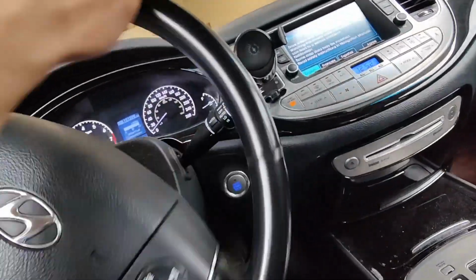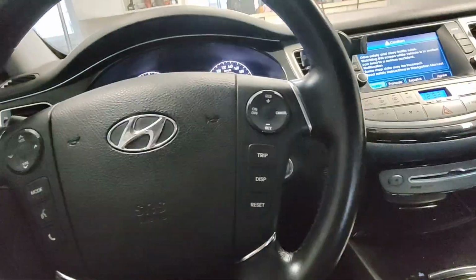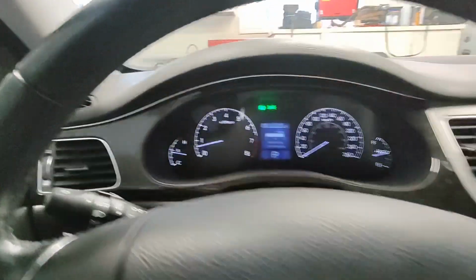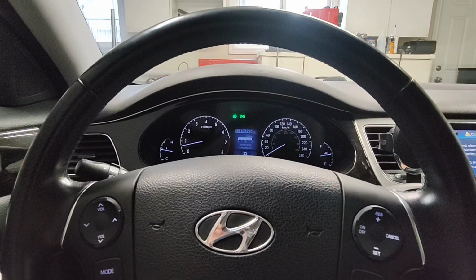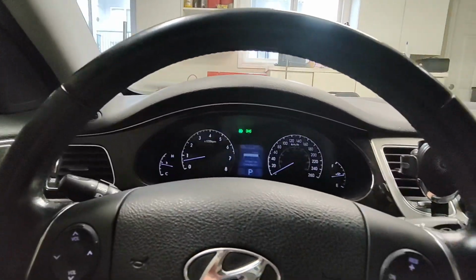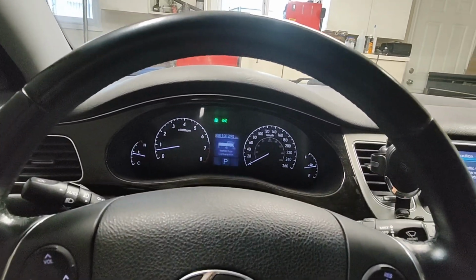Yeah, so you all know I work at Hyundai, and I get a lot of customers that complain, hey, it stalls. Their car stalls when it comes to a stop. Or I had one weird one where they're just driving, and then the tach just shows 0 RPM. So we usually keep a lot of these crank sensors in stock for the Elantras, Hyundai Accents, the Velosters, because they all use pretty much similar engines, same crank sensors. But not much for the Hyundai Genesis, because we don't get that many Genesis customers come in, I guess because there aren't that many out there.